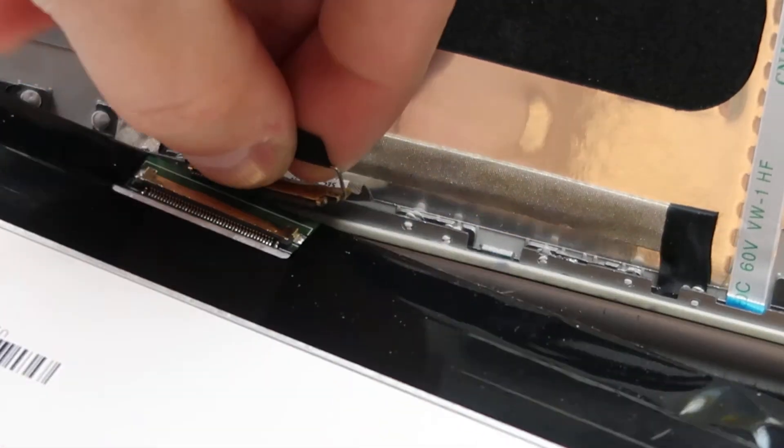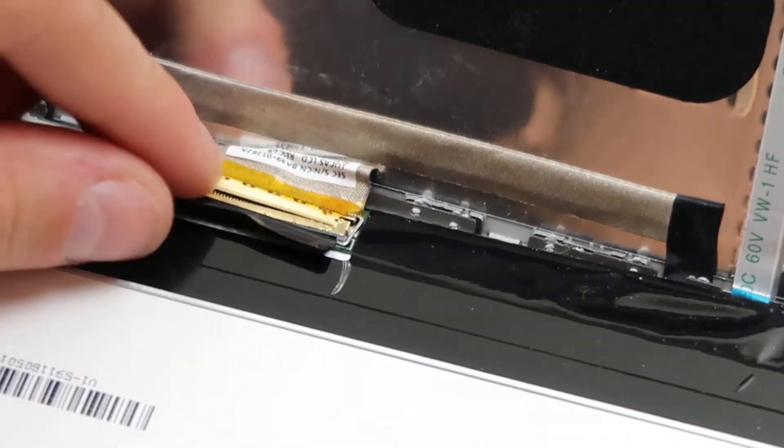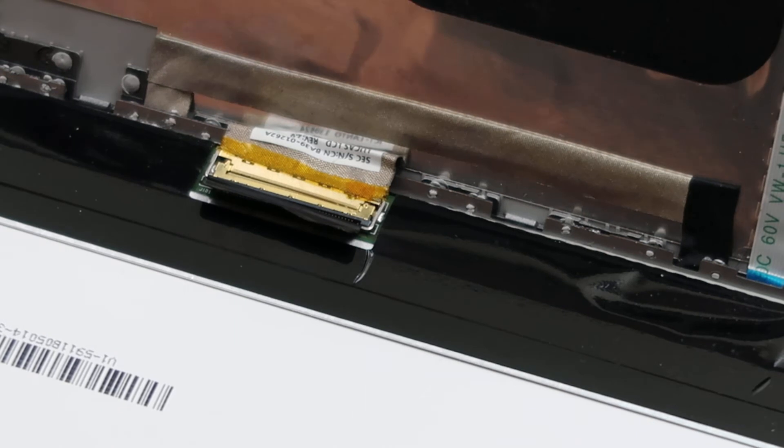We'll put that off to the side, bring the other one over, and just go in reverse. There's not a lot of wiggle room there, so take that and just try to put it right where the other one was. So we just got that one in. Doesn't look really flush — let me try that again. These can be a pain sometimes. So that looks like she's in there pretty good. Now, in order to keep it in there, what I always do is put some electrical tape down. Usually they'll already have it there, but for some reason this computer didn't. I'm going to put the tape on that to keep it secure and tight.